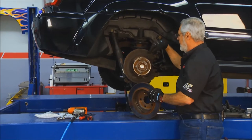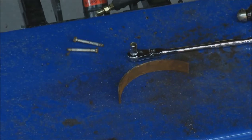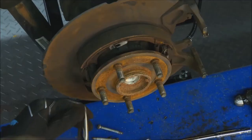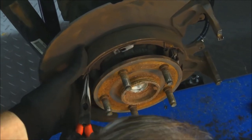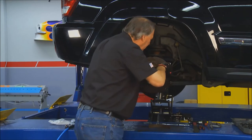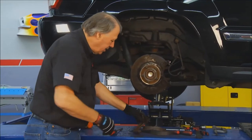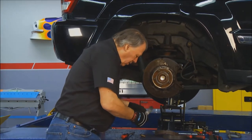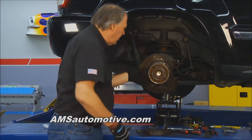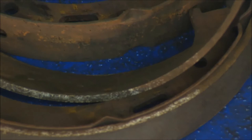You can see in here there's a reluctor ring and a tone wheel for the ABS brakes, which this Jeep is equipped with. This thing's been driven with the parking brake on — it's hot, so the liner let loose. That's why this thing was making noise. Now we're going to take these brake shoes off. The bottom liner fell off of this one. It's a little bit rusty, not real bad. These are all held on here with springs, so we'll take the springs off and get these coming off. Now we've got our brake shoes off — here's what they look like, and this is the liner that goes on here. We'll go ahead and clean all this up, make sure it's nice and clean, lube it, and start putting this back together. In the meantime, we're going to take a short break.